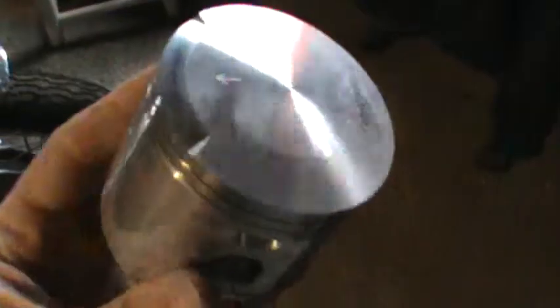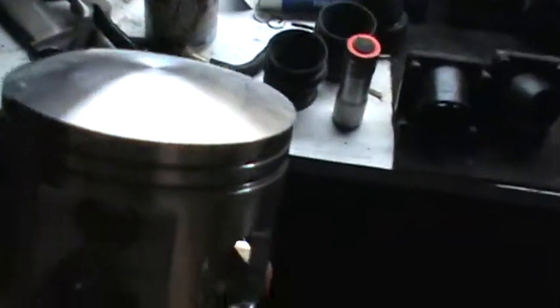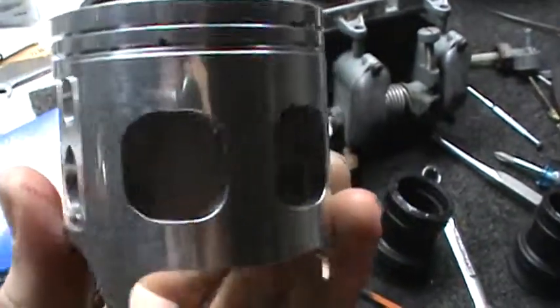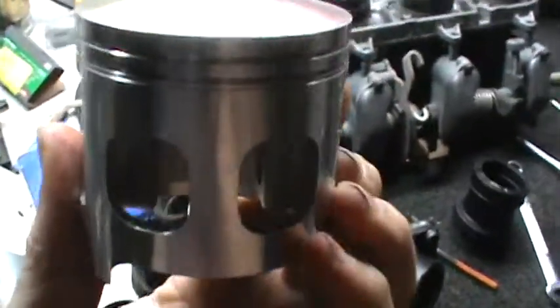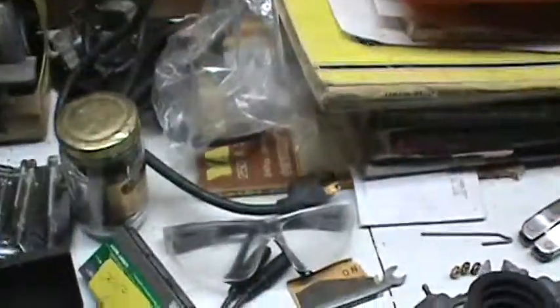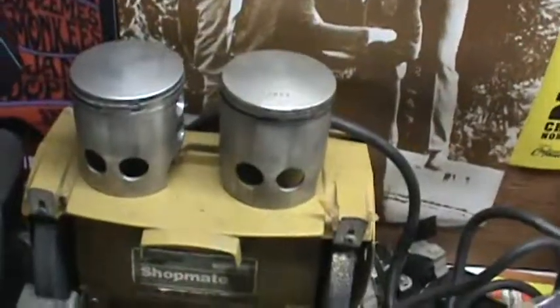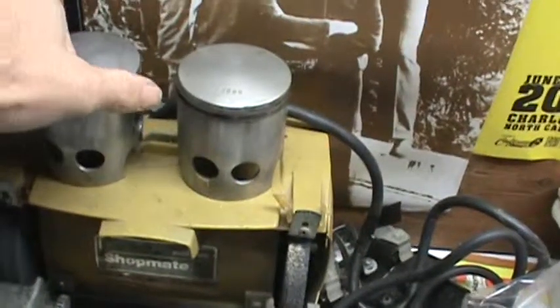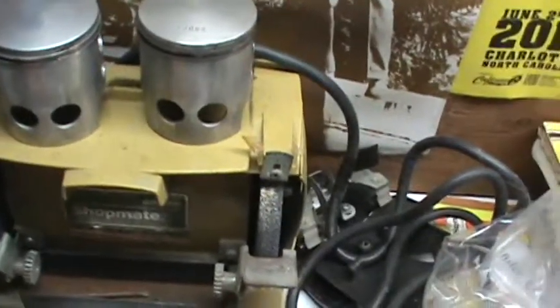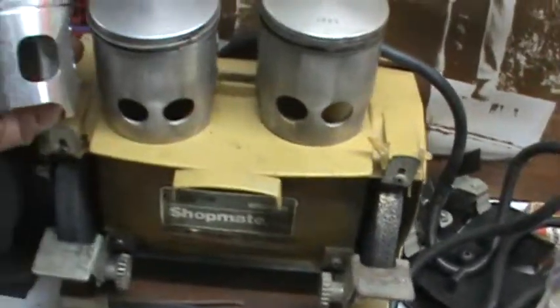Brand spanking new pistons, and these actually have a cutout — as you can see the front ports, the induction ports are huge. The intake is supposed to simulate engine porting. These are stock banshee or Wiseco RD 350 pistons, and they're forged — just like these guys. You can see the intake versus these monster, massively larger ones.